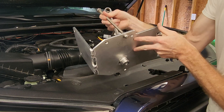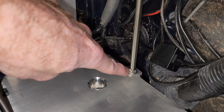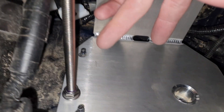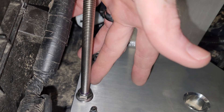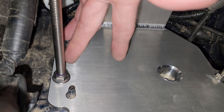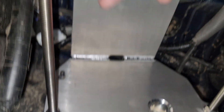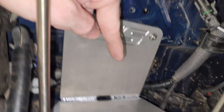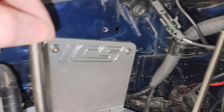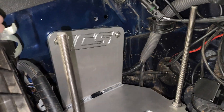We've got the tray installed — that bolts in there and that bolts in there. On a quick side note: the locking nut is on the bottom, but I had to move the other locking nut to the top because it's just a hair taller, which was not allowing those bolts to line up. So put non-locking nuts on the bottom. To me it doesn't matter if they're locking nuts up top — they're easily accessible and I can check on them from time to time. Now I'm going to drop the battery in and wire up the RedArc.